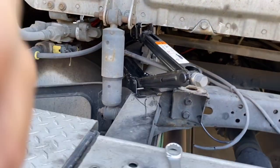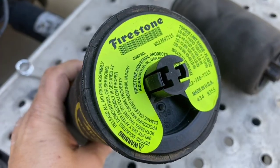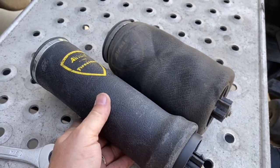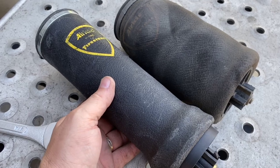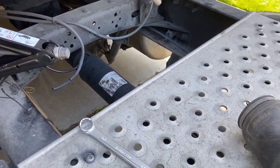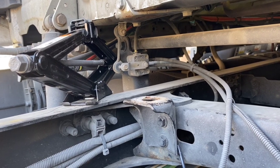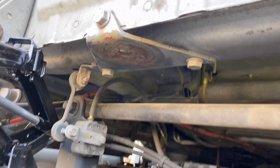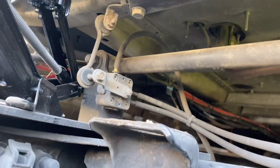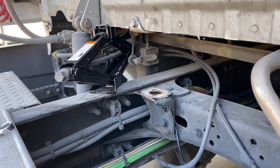Here is what our new airbag looks like. I'm going to put it in the same way — air to the bottom, this goes into the top. This is going to be a little more difficult because there's a height difference, so we just have to push in on it a little bit more, but it'll go in. You're always going to put the top in first and then wiggle in the bottom. Then we go under the truck, simply reconnect the airline, and we're done.